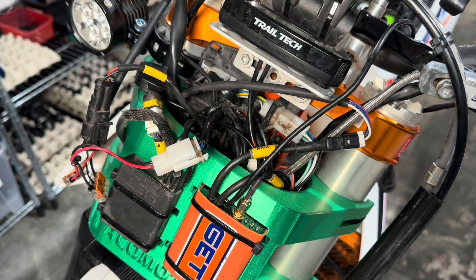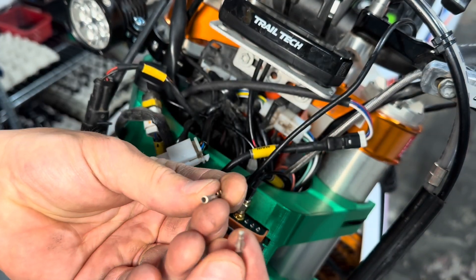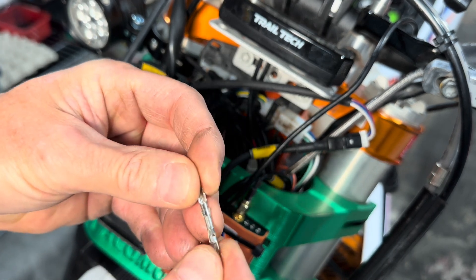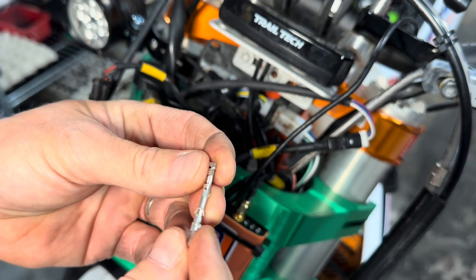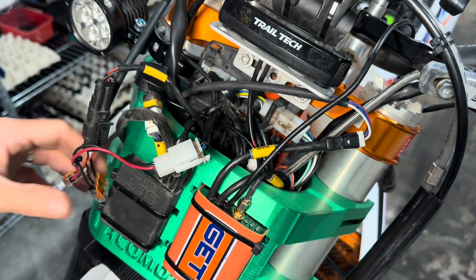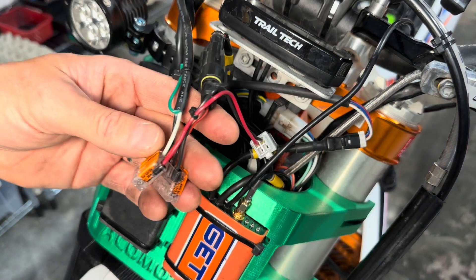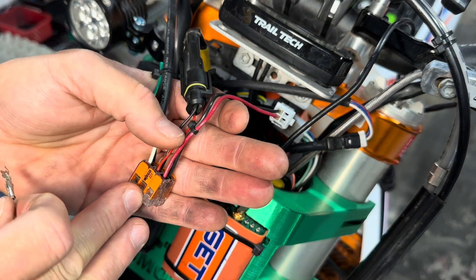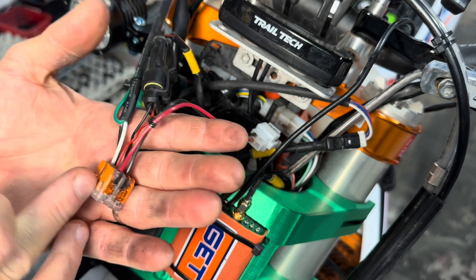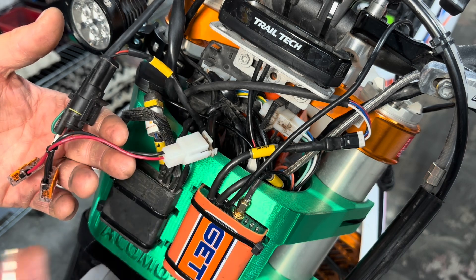The pins on these are a press-in type connector. Inside that housing you have these little bullets — a receiver and a pin — and these just friction fit into each other. So these are all subject to corrosion and degradation because they're open, which is exactly what this is. The thought is: will these degrade, and are they suitable for use on a motorcycle? Well, these types of connectors that you already have on your bike will degrade, and these are the exact same type of connectors.